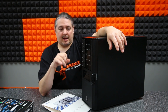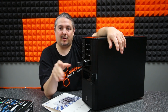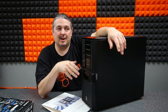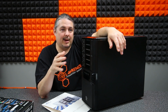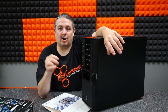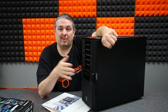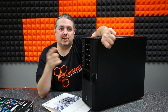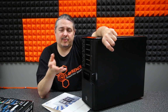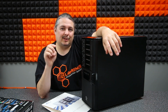Now, another consideration with FreeNAS, when you're ordering these drives, don't order them all from the same vendor at the same time. The problem you run into is, let's say there was a bad batch of drives. Vendors, large scale, Newegg, Amazon, wherever you're getting them from, Micro Center, they order batches at a time. So if you have an entire large batch of drives and they were all bad, that vendor may have an entire pile of them all bad. But when you order from different vendors and different pools, you'll find that the drives have slightly different build dates. So statistically, and this is just a guessing game, of course, they're less likely to fail.